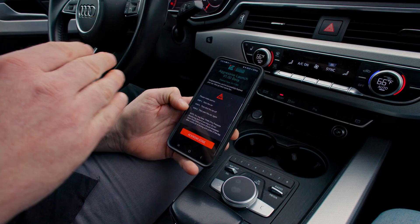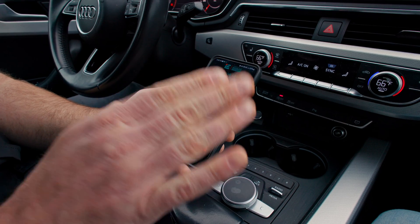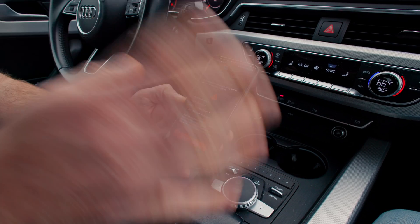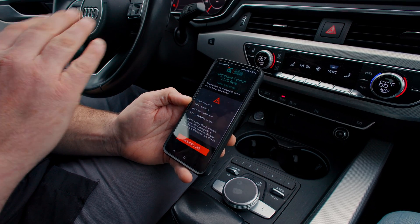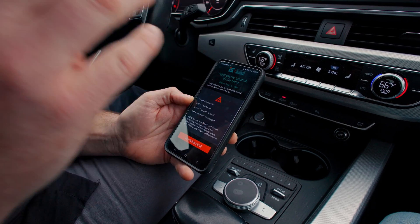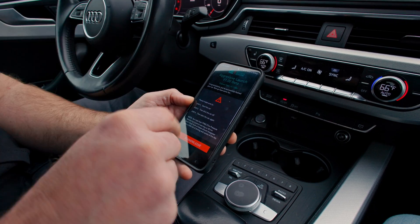Keep in mind that is a regular flash just like you're flashing the TCU for the first time when you're changing launch settings, so it's normal for it to take a little while and for lights, buttons, and error codes to pop up on the dash. That'll all go away once you start the car, shut it off, and then start it again, which is the next thing we're going to have to do before we can go driving.